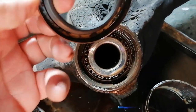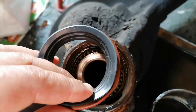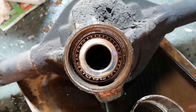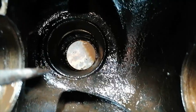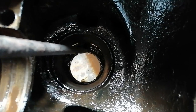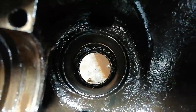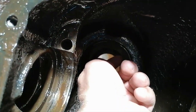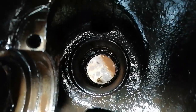I've already got the seal out — I've done this all off camera. So this is the seal. That's the next bearing to come out. After this I'm going to clean up a little bit and start replacing the bearings. In order to get those outer races out I must knock down here — there's a bit of a landing there that will knock the outer race out. You can see here the outer race of the other bearing, and at the back there's also a landing to knock the races out.